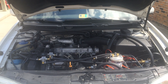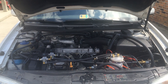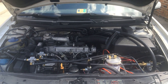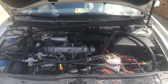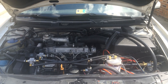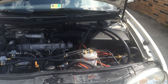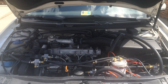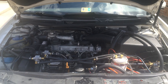To run straight vegetable oil — you may not know this — you do need to heat it. That is the one thing that will allow the oil to run just like diesel fuel. If you can heat it to about 170 degrees, anywhere from 160 to 180, I've heard works well. 170 is pretty optimal. It will run just like regular diesel. So I'm going to show you how I go about heating this oil.